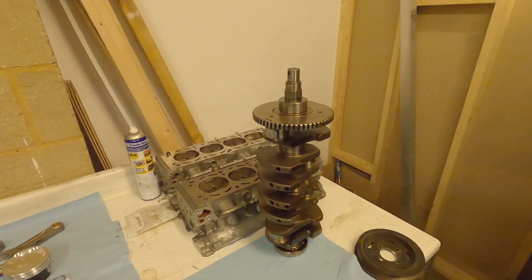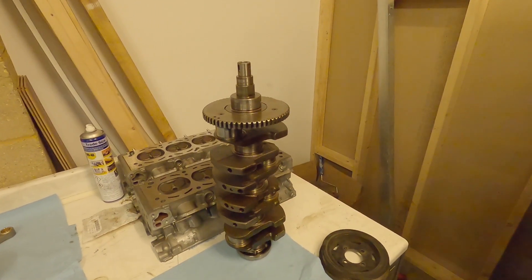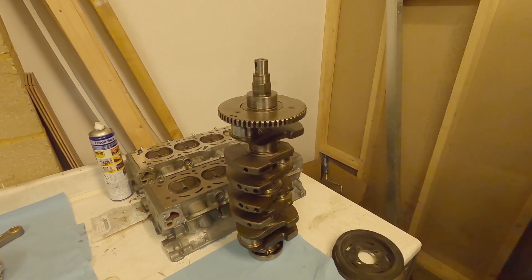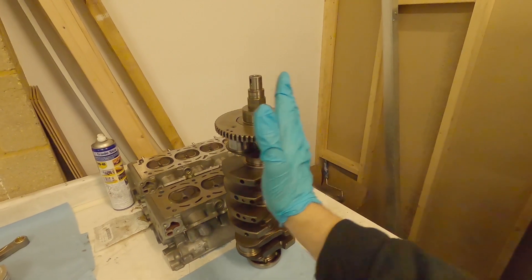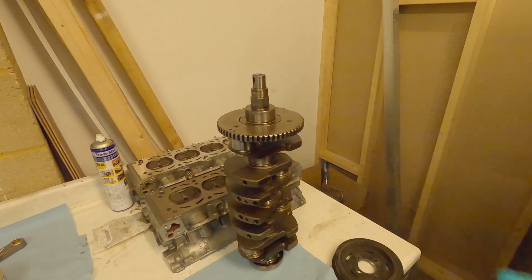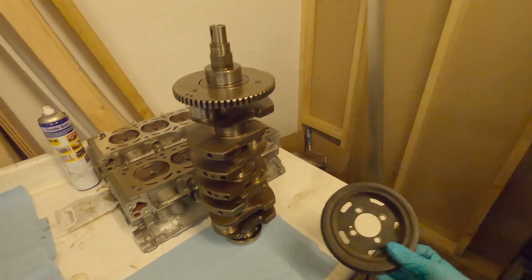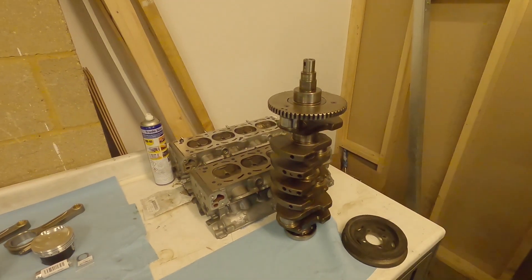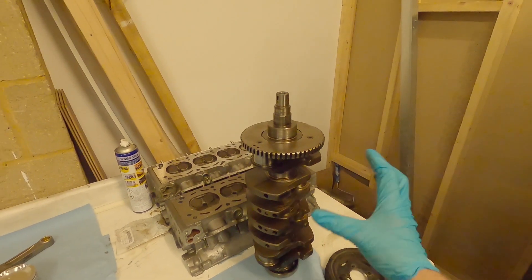If you're only at 6,000 rpm and the amount of oscillation is acceptable, that's fine. But if you increase your engine revs even higher, the amplitude of that oscillation as the frequency increases is going to get even higher. Another factor is people like to remove heavy harmonic dampers and also replace dual mass flywheels with single solid mass flywheels, but all these devices are there to counteract and dampen the effect.